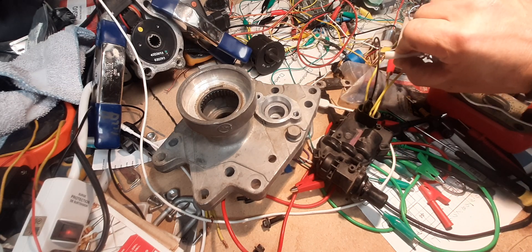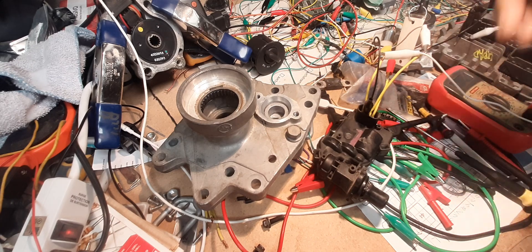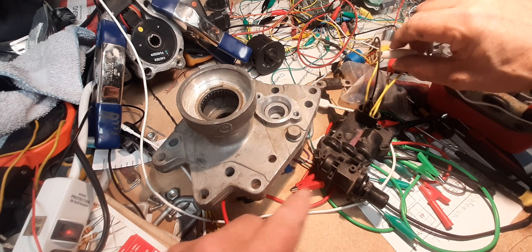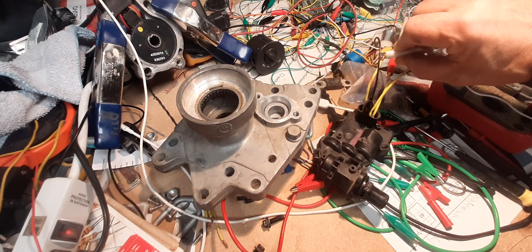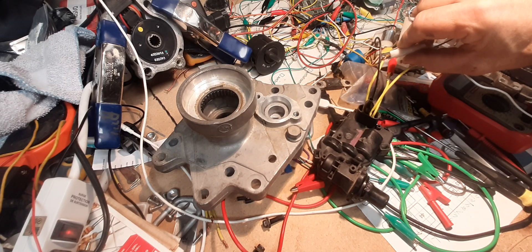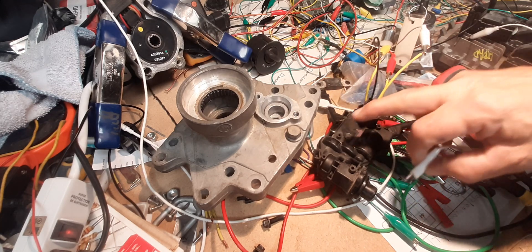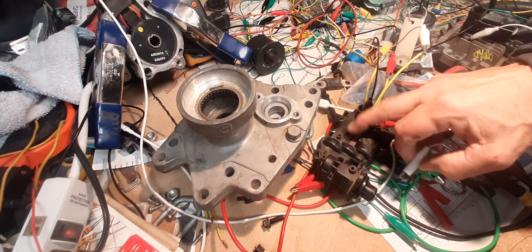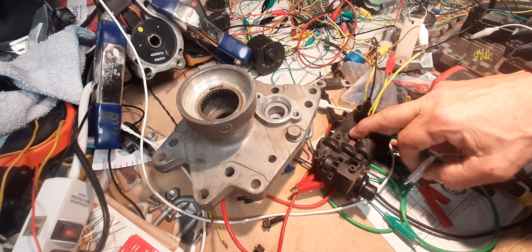If I disconnect here, you'll see that plunger — that's back for two-wheel drive high. This is for any four-wheel drive mode, including automatic. You should hear this noise when you switch out of two-high into any four-wheel drive mode. If you're not hearing the noise, you've got to check out your actuator and your wiring. The fuse that supplies power to this actuator is number 51 — it's under the back seat — it's called the four-wheel drive fuse.